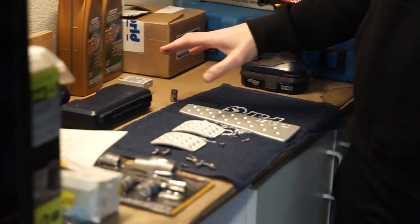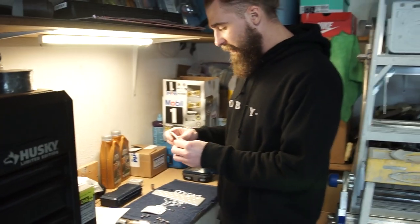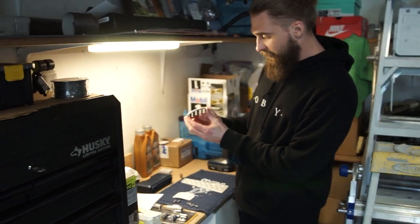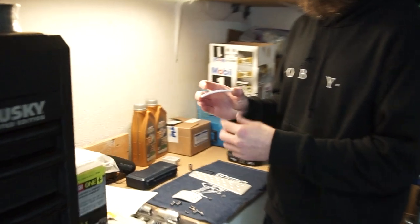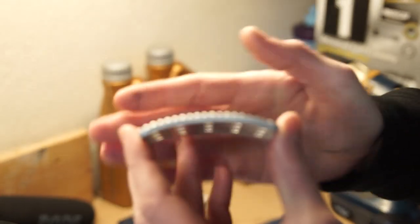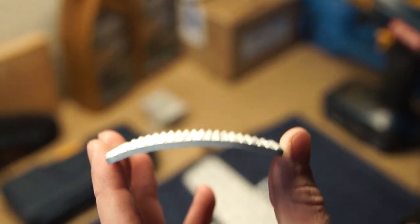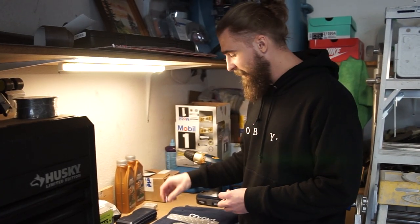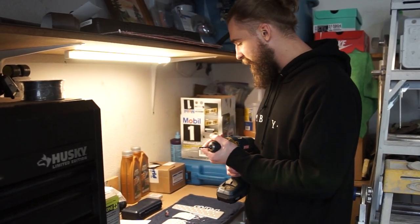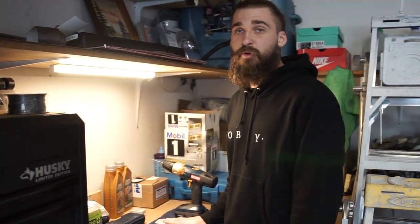These pedals I got from Pelican Parts. These are Turner pedals — they're grippier. If you can see the ridges here, they're super sharp; they're going to be much grippier for the feet. These pedals come with a few things: all this hardware and an Allen key. You're going to need a 9mm socket and a drill as well, 3/16ths. You're going to need to drill some holes in your original pedals, and pretty much that's it.